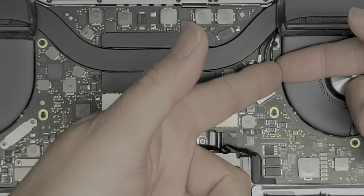Get the bottom cover — line it up, slide one corner in, then the other side the same way. Pop it back in — push the middle, push the sides. Switch back to the Pentalobe 1.2 and put back all the bottom screws. That's pretty much all there is to it. Hopefully this video helped you guys — if it did, please like and subscribe because that will help others find my videos. Thank you for watching and I'll see you in the next one.